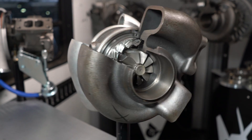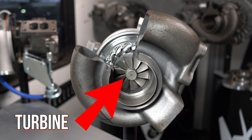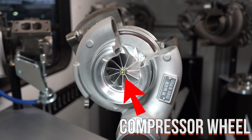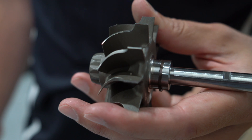The turbine is the engine of the turbocharger. It's connected to the compressor wheel and it basically determines the potential horsepower that can be driven by the compressor. We need horsepower to compress air to get it into the motor. The more turbine horsepower we can make, the more airflow we can generate. Let me show you what I mean.